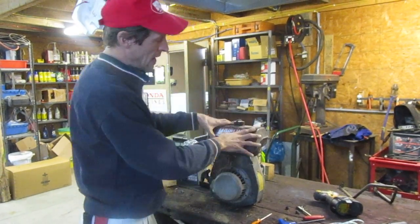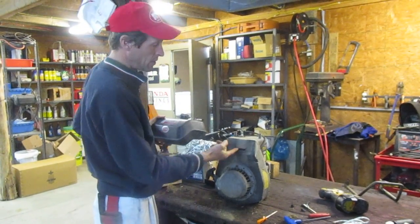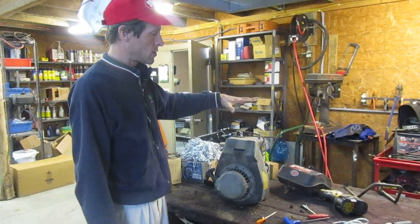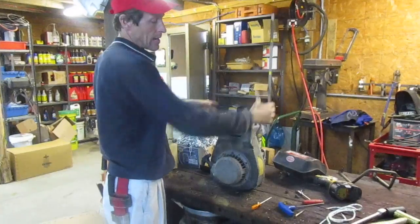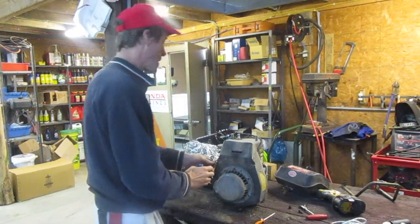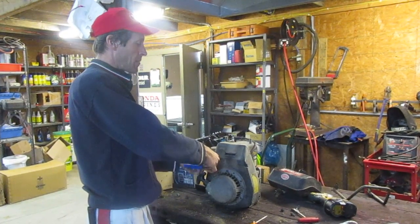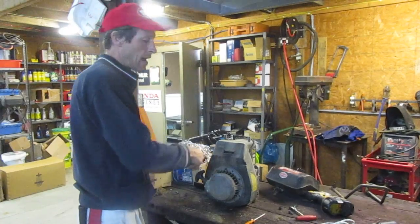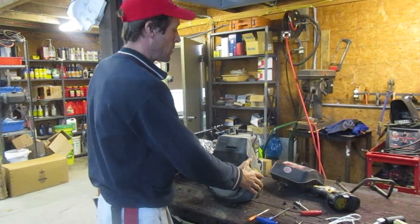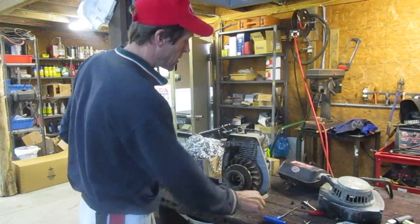On this particular engine, the gas tank is in front, so I'm removing that. There are two bolts on the top and a little tab that tucks in on the front of the engine. On many of the engines like this in circulation, the tank is mounted on the backside of the engine — and also the ALN 215, 290, and 330 with points and condenser ignition.